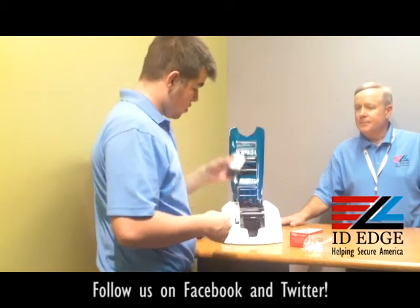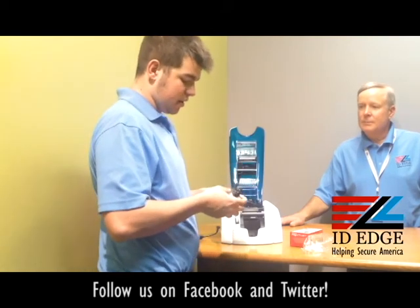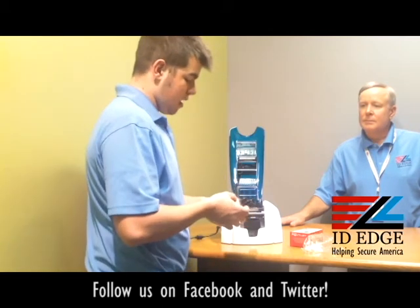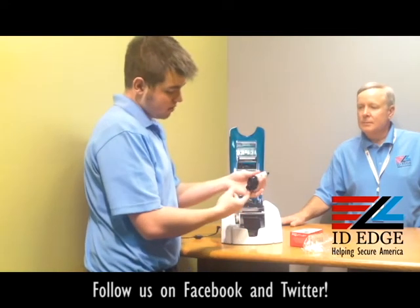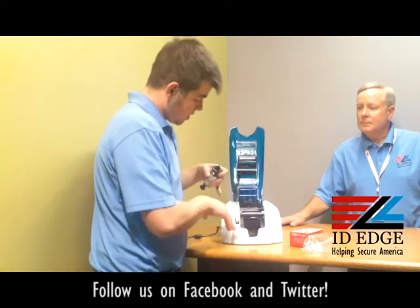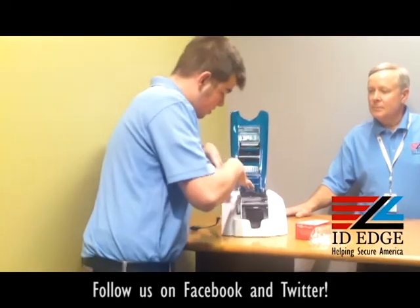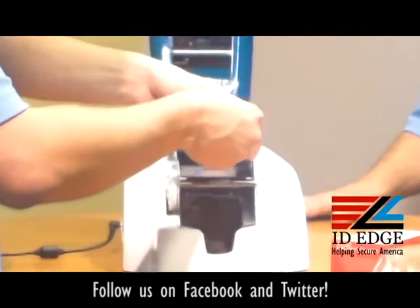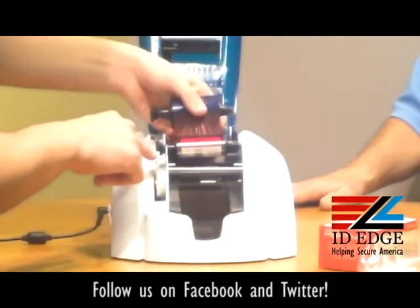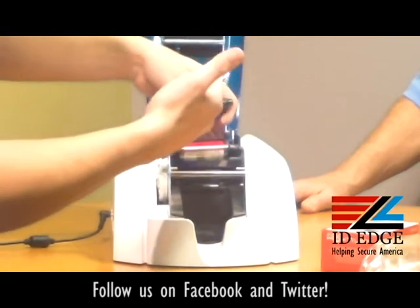Now that's ready to go. When entering the ribbon into the printer, you can peel that off, and I like to roll it up a tiny bit until you reach the color. The next thing is you see the dials, or the gear-looking ends to the ribbon — you're going to see a gear here and a gear here. This one's kind of hidden but it's down there, and you can see it from looking straight over it. You're going to want to line it up. The smaller one goes in front, it's going to go over the top and not under — that's another way to know.